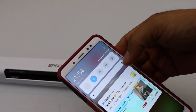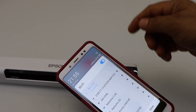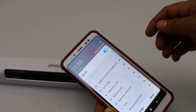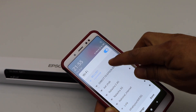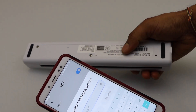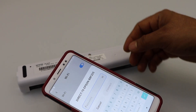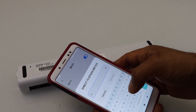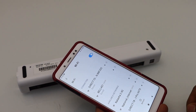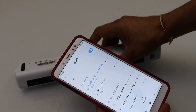Now go to your Android phone and open Wi-Fi settings. You will see 'DIRECT-70 Epson' — that's the name of the SSID of your Epson scanner. Once you select it, it will ask you to enter the password. The password is written below the SSID name and should be different for each scanner. Click on Connect. Our phone is now connected with the scanner.